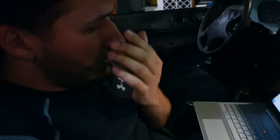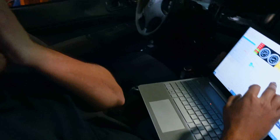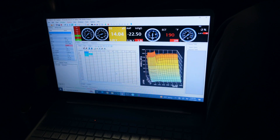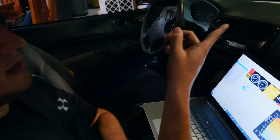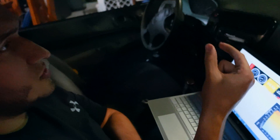So what's going on? We were making changes because the AFR was reading 11 here, but the actual air-fuel ratio was getting like 10.0, so the car was literally falling on its face — running rich. We were going based off that reading, and it seems like, kind of what he was saying, on that downpipe, the AFR sensor might be too close and the boost is throwing it off a little bit.